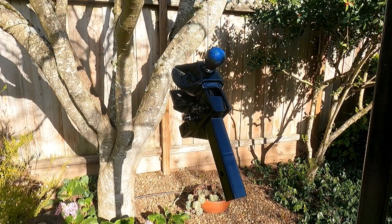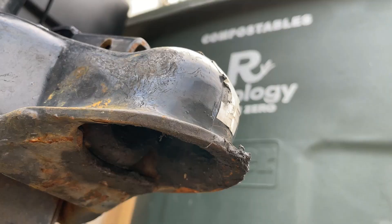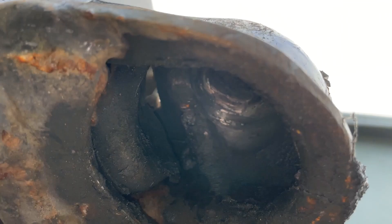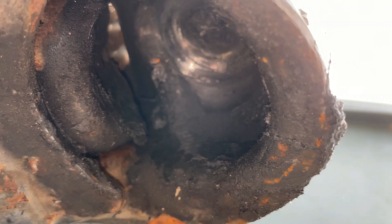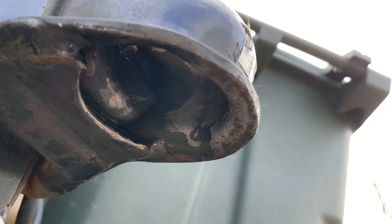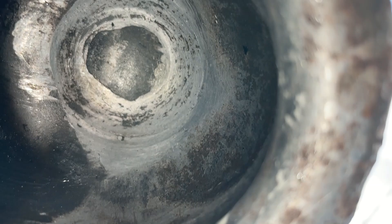This is a good time to check under your receiver hitch — give it a look, clean up the grease, and inspect for damage. Make sure everything moves properly and lubricate as needed. I cleaned it up with brake cleaner as best I could, didn't see any bad scratches. I'm going to touch up some areas with the rust neutralizer, prime it, and paint it up. Then when I put everything back together I'll lube up the ball and make sure I get lubricant inside.